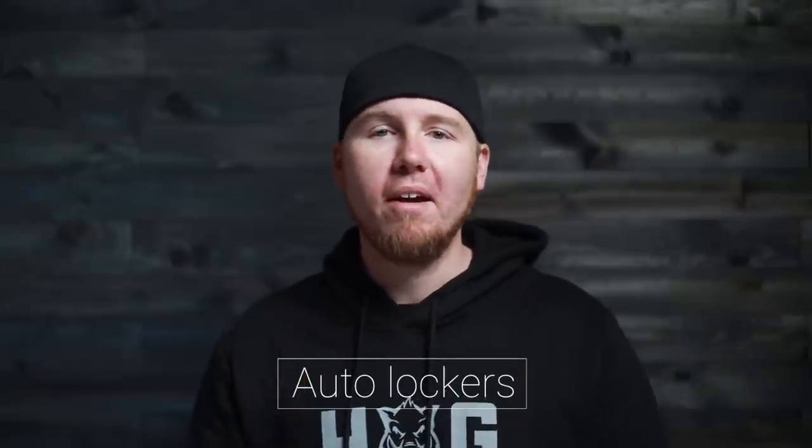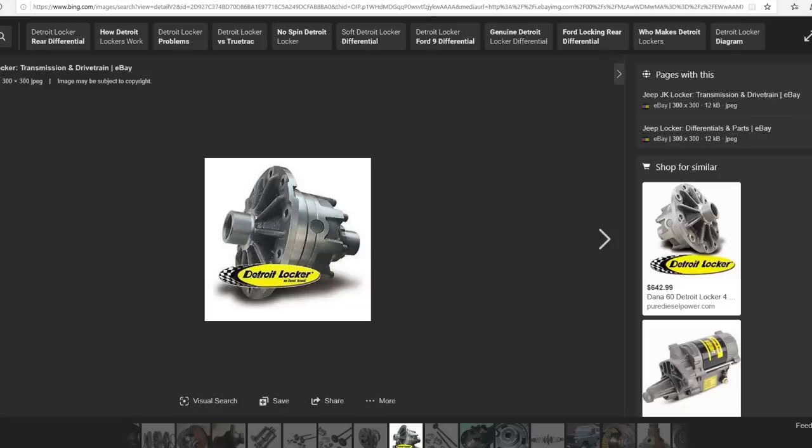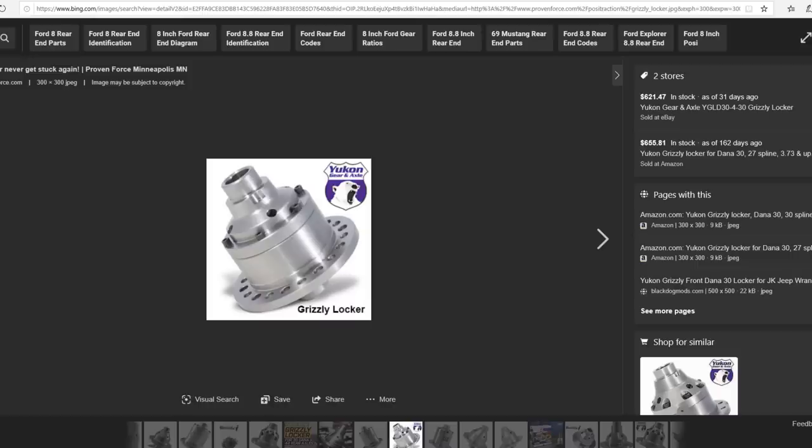The next category is automatic lockers, like you'd find from Detroit or from Yukon — a really good option for a lot of people in my opinion. I really liked my Detroit for the time that I had it. The Detroit soft locker was really strong, and I've heard really similar results out of the Grizzly lockers. This kind of has a mind of its own — you don't have control over when it's locked and unlocked. In a perfect world, it's designed to be good on the street, so when you're taking a corner and not throttling through, it should be unlocked and function very similar to an open differential. Unfortunately, it doesn't always work perfectly — most of the time it performed great on the street, but there were times where it would unlock and lock at will, because it's guessing whether you need traction mechanically, with no computer.